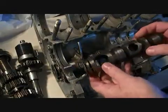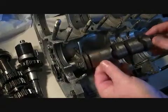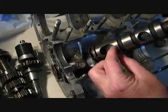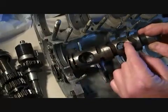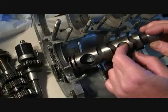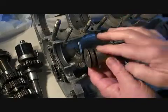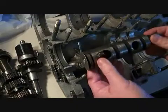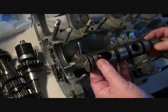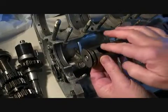Another thing before you install the shift drum: if you do pull it out and remove the forks, this is the old broken one. You can see where the holes are cast in the cast iron — there's a sharp edge right around there. What you really want to do to make a smooth movement is file or die grind all these sharp edges nice and smooth. These things can crack if they're under load, and that's a big problem. So you want to chamfer all the way around.